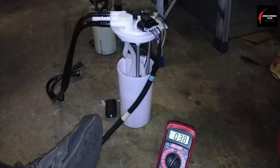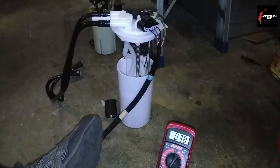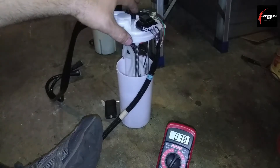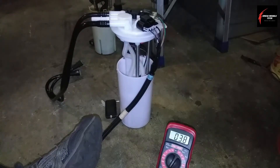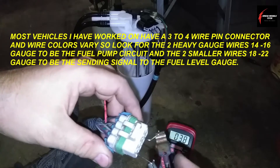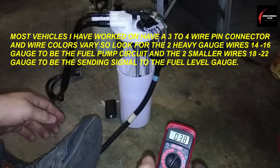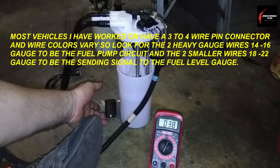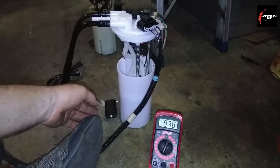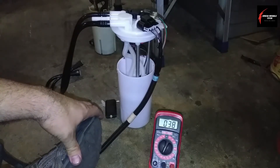In this clip, you'll see that I got the new pump here and I got my connector all wired up. In another video, I showed how to solder these wires with a pinout diagram that came with the manufacturer of the new fuel pump. I've got my connector connected to the pink wire and the black with the white stripe. At rest it's just 38 ohms, and then as you can see, it goes up gradually to about 250 ohms. This is the information signal that is sending to the gauge of the vehicle.